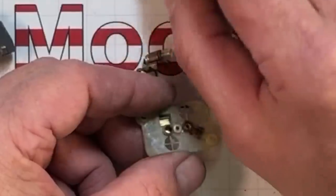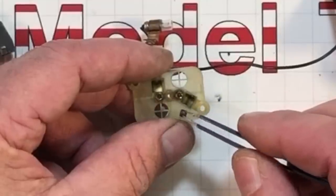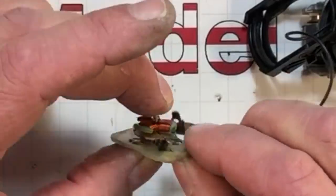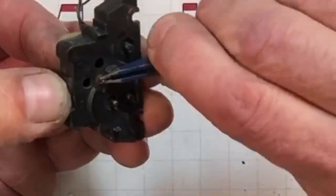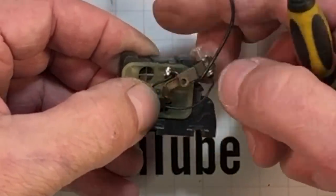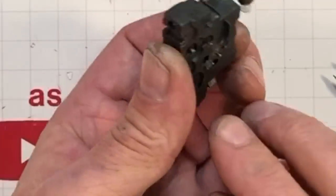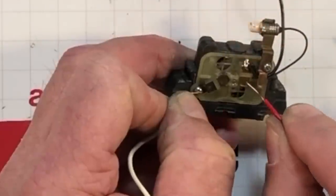Put a little oil down this bearing, get your springs in. Don't lose them and don't let them launch across the room. Balance the brushes up on top — you can see them sitting there. You can't tip this or the brushes will fall off. Insert the armature shaft into the bushing and get everything lined up. Get the motor lined up on the hole, make sure you can still turn the motor. Finish up bolting this on. The armature, commutator, and brushes have been serviced. I wiped the oil off so I'll give it another tiny taste. That's what a serviced motor looks like right there.